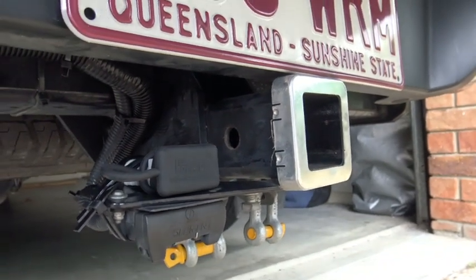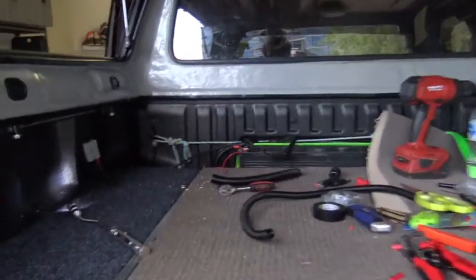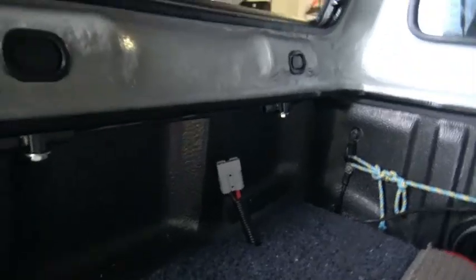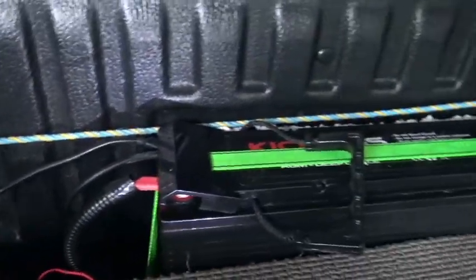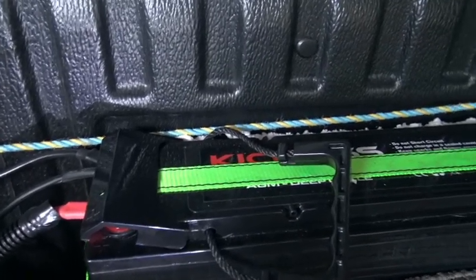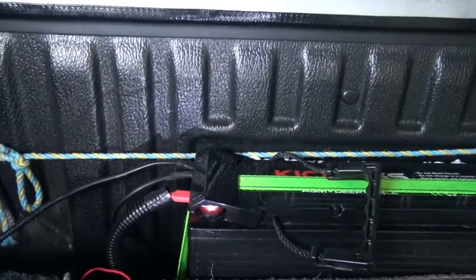Check the voltage at it - no voltage drop from the battery, pretty happy with that. And that's going to run all the way through the camper trailer to another DC-DC charger which we'll have a look at a bit later. Got the DC-DC charger all wired in - the Projecta IDC25. I've hidden it underneath this wing here on the Titan ute drawers. Comes all the way back to the Kick-Ass 170 amp hour slimline AGM battery. Got it from Australian Direct on the Sunshine Coast - really good fellas to deal with, very helpful over the phone, couldn't fault the service. They let you pick up stuff too if you're in the area.